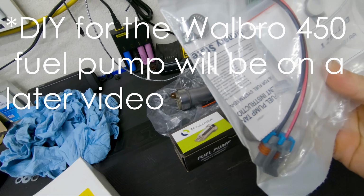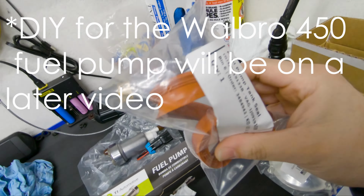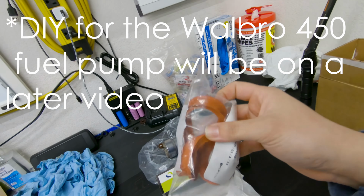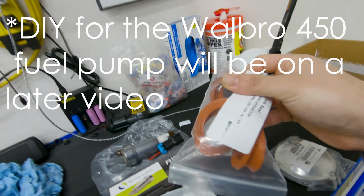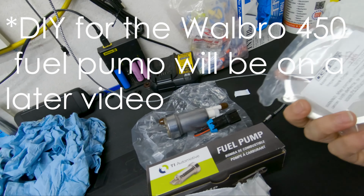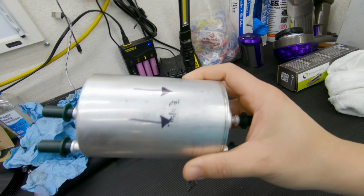Here's the accessories that came with it. So this is actually separate from that. A new gasket, since I will be opening it. When you open that, this tends to expand, and when you put it back in, it just makes it difficult. So it's just good to go ahead and replace this. And then here is the bracket for the fuel pump. With the new fuel pump, I might as well get a new fuel filter as well.